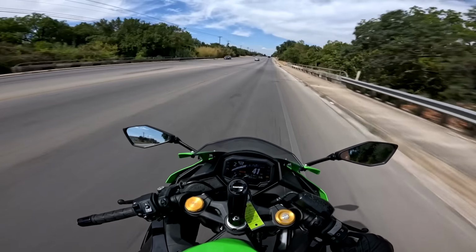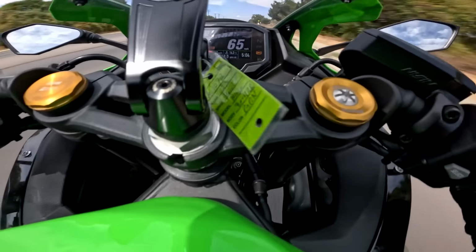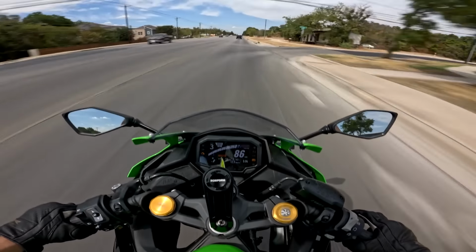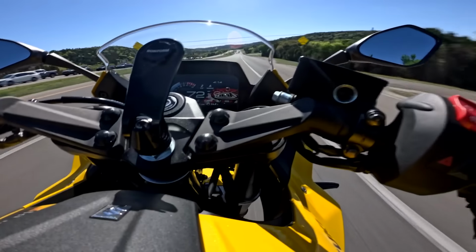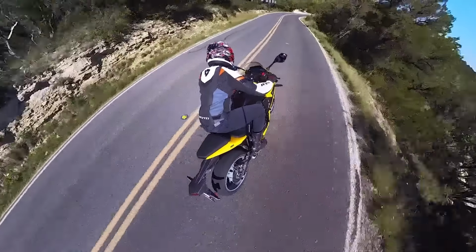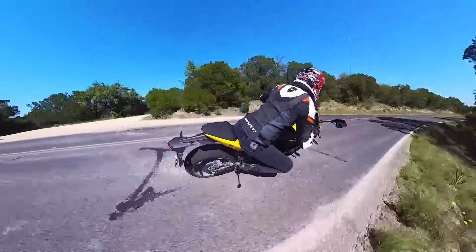The small, high-revving engines found in most motorcycles encourage you to rev the engine way past to the higher RPMs. In most cases, a motorcycle will benefit from higher revs. They're designed to do that. If your bike has a 10,000 RPM redline, what good will shifting at 2,500 RPM do you other than bore you to tears? Like I said, a motorcycle engine is designed to be revved out. You'll continue to make a lot more power, and your bike might even run a little bit better.